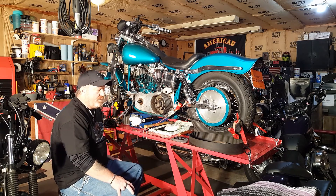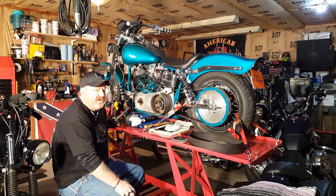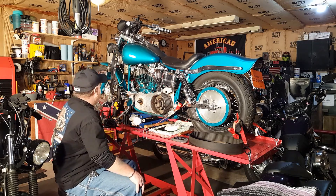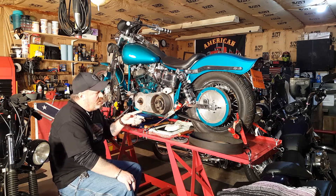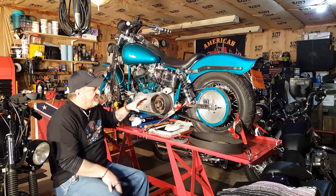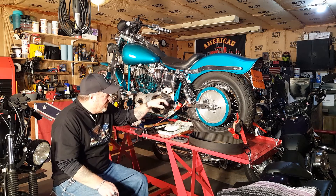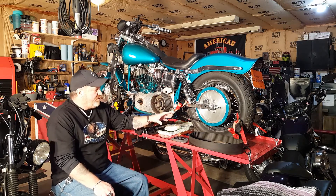They paid for all the towing and storage while I was laid up. Some friends of mine went and got the bike back a week or two after I got out of the hospital — I had emergency surgery and all that. But yeah, this is what I built. It's got a '77 front end and an '83-84 Sturgis rear end. The '72 was really narrow at the swingarm bolt, so I got a wider swingarm because I wanted a belt drive.